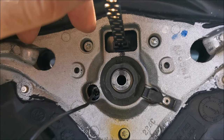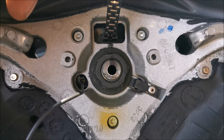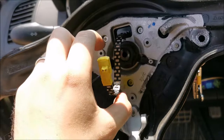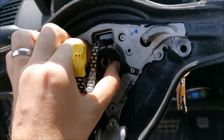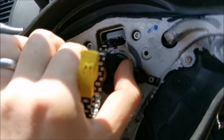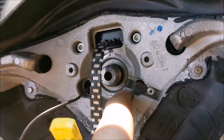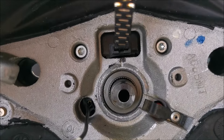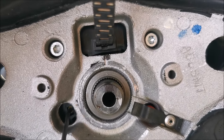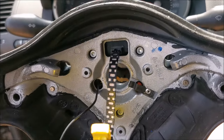We have a marking from the start, and the steering wheel nut is an M24 socket hex socket. It's tight, but not overly tight. With normal tools, holding the steering wheel, it's doable — if you have a second person to hold the steering wheel, even better. We do have a marking on the steering wheel — that little dot — which aligns with the steering column. They are about one millimeter off at the moment, but okay. From what I know, you can just wiggle it out — and here it is.